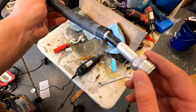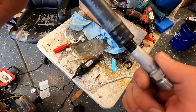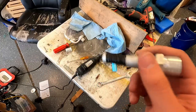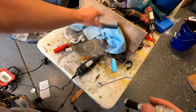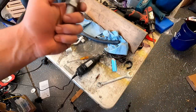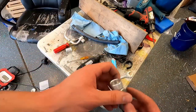This is literally the hose that came off it, so it should be in tolerance. So I'm not worried. I'll order some hose and some new fittings and a ferrule. I'm also going to use the fitting that I welded. I'm going to make two lines before I decide what I'm going to use. I guess I'll pressure check both. I'll hook them up, vacuum test it. If I can pass vacuum test with this, then I'll just get rid of the other piece.